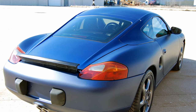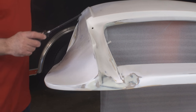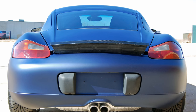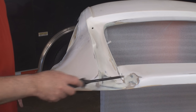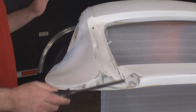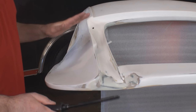This is why you have to fit the top prior to painting. When it comes to fitment on these tops, basically there's a front latch, there's two spin locks, and then this back piece goes across the trunk. Depending on the height of your trunk lid, in order for the rear hatch to close completely, we had to reduce the height of these two pieces here.